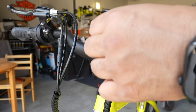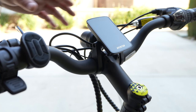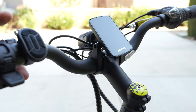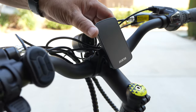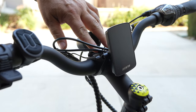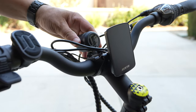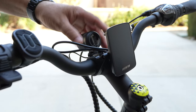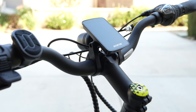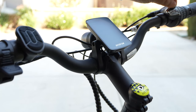There's another piece of film on the front light — make sure to peel that off too. Out of the box, everything on the handlebar is going to be loose: the display, the light, and the handlebar itself. Make sure you go back over all of this, get everything right where you want it, and tighten it all down. You're going to have two screws here to tighten up, two down here, and on the display two on the sides, and on the light one right here. Get it right where you want it, tighten it down. There's one more piece of film on the left on the gear shift — you can remove that too while you're at it.